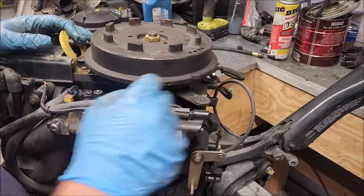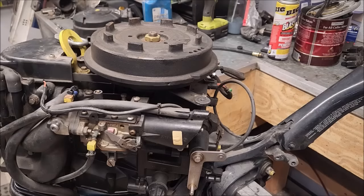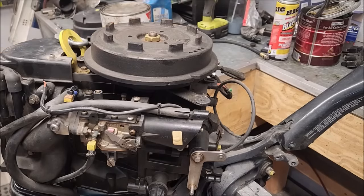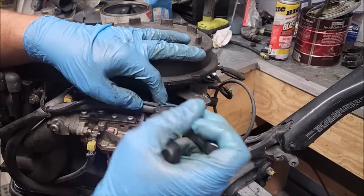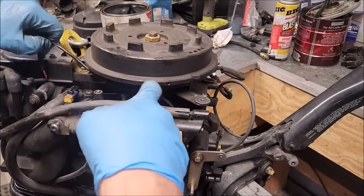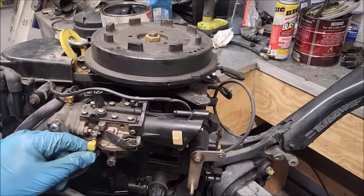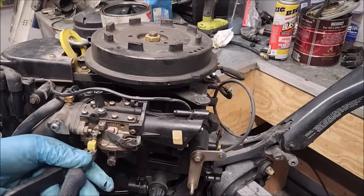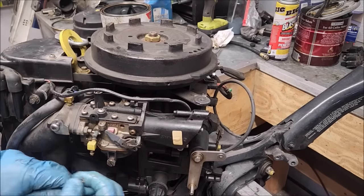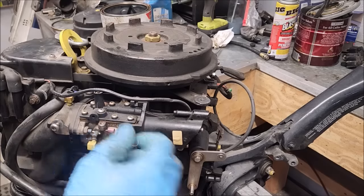So I want to get the carburetor off and start getting that clean. That sucks doing that. Alright, zip ties. We'll see you later. If you're wondering, yes, those actually are supposed to be there. Split hose. All right, get this off. We don't have a plastic fitting, meaning we can get to the top of the hose and use our diagonal wire cutters to slide the hose off. That way, we don't have to replace this hose every time, because this is like 2 feet long, 2.5 feet long, and at $9 a foot, if you don't have to buy 3 feet of hose, you're doing good.